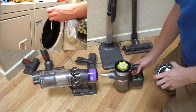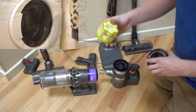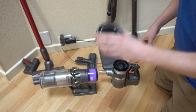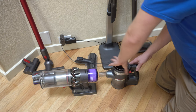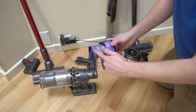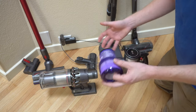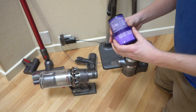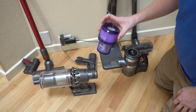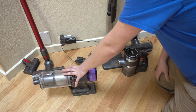Apart from emptying them, let's talk about filters. The LG A9 has two separate filters, and I think this is a better system than Dyson. They give you two of these filters, which is a big plus — they're washable. You'll need to wash this every time, and then the HEPA filter you can change every six months to a year. There's no generic HEPA filter available for the LG that I've seen yet. With Dyson, you still have two filters, but they've put the washable and the non-washable together. Dyson does say you can wash the HEPA, but as we know, paper filters don't particularly wash well — trust me, don't wash the paper. You'll need to change the Dyson filter assembly every six months to a year. The good news is there are plenty of aftermarket filters for Dyson — I'll put a link below. You do have a little more aftermarket availability because of the popularity of Dyson products.